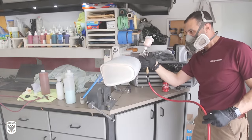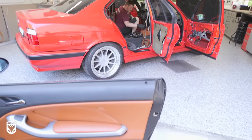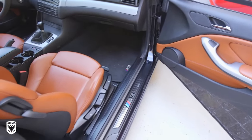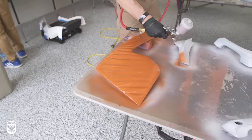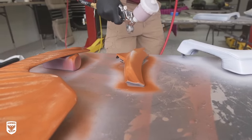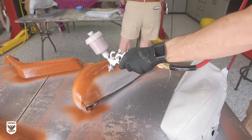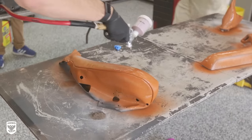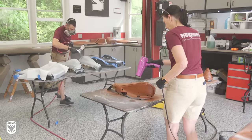After two or three coats of the white primer-ish dye, each panel is ready for the first layer of the customer's desired color. For the E34, he's chosen BMW's OEM Cinnamon. The special cinnamon dye and thinner are added to the paint gun and the first light coat is applied to all the parts. For a project of this size, Brian disassembled the seat's side bolsters to ensure the dye covered every square inch, so nothing would be visible if the seam was pulled open during inspection. After each light coat, the team dried the parts with the hair dryer while leapfrogging each other to keep the project moving.